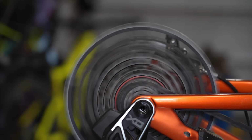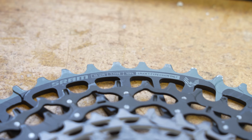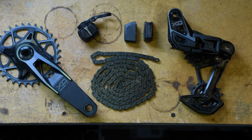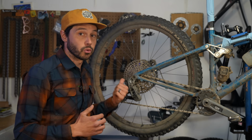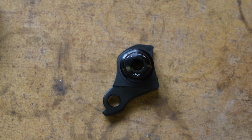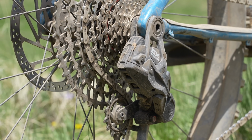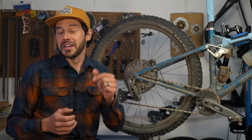So to rewind a little bit, SRAM introduced their XXSL, XX, and XO Eagle transmission systems in March. And I did a whole video on that, which is linked in the description below. It's a hangerless interface with the derailleur mounting directly to the rear wheel axle. Because of this, it has a very special install process that essentially replaces the adjustment points on the derailleur itself. SRAM claims that by removing the derailleur hanger, the cassette and derailleur work better together, creating a more precise shifting experience. And long story short, I have to agree, but more on this soon.